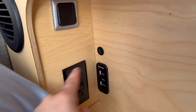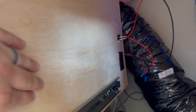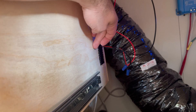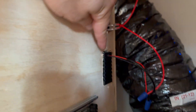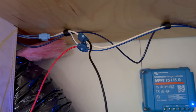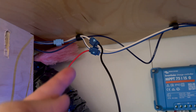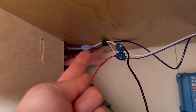Now we should see a better look in here. So here is what I did: I got a little 12-volt switch, and that is powering my USB right here. In order to mount this, I figured out that the back of the drawer stops two inches short of the end here, so I measured and marked and made sure it was not going to hit the back of the drawer. That gave me a convenient mounting spot for the switch and the USB outlet. For my 12-volt supply, every trailer is going to be different, but in this case there must be 12-volt going over there because there's that switch. I found that blue wire and white wire with the little connector — this is what was powering the light switch.